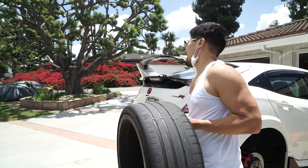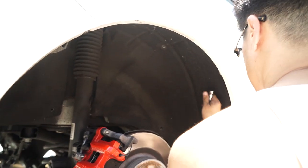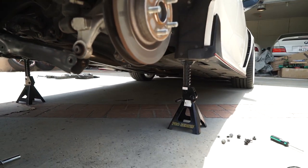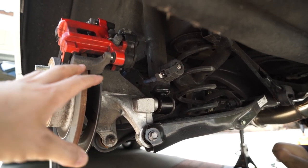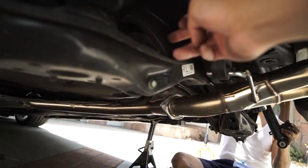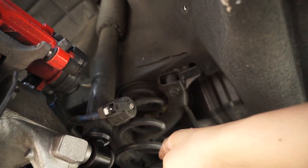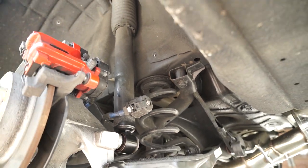Taking off the stock rear wheels and removing the fender liner so you can get better access to the top two bolts. For the rear suspension, what you have to do is: take off the bolt that connects to the sway bar, and then the strut just drops out so you can remove the spring. The strut itself is easy — just two bolts at the top. You also have to disconnect the sensors by releasing the two clips that hold them in, and then you're good to go.